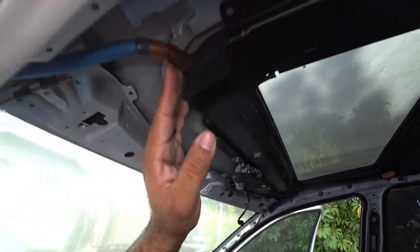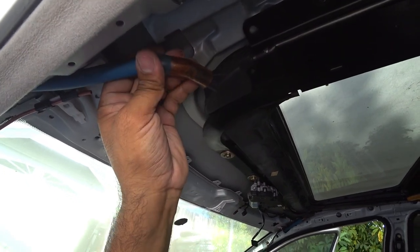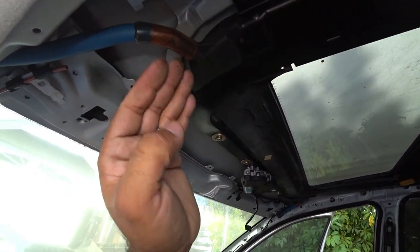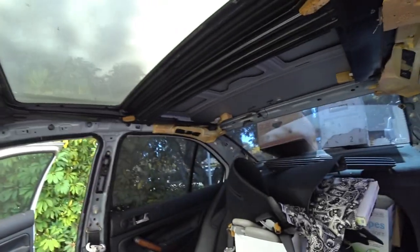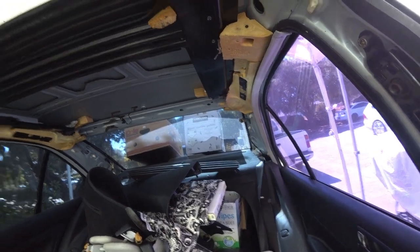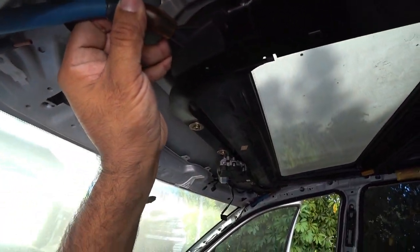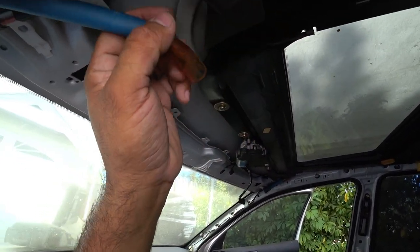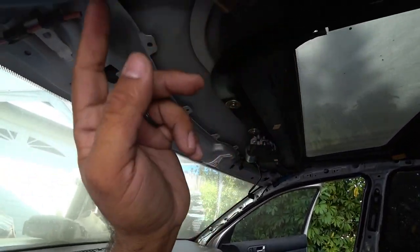We're going to put them with brand new tubes, but they're all the same size. This will solve the problem where your drain tubes leak. We're just going to fix the sizing and run new tubes all the way down from each corner. You get the proper size tube that mates up to this, which looks like a three-eighths, and run a tube all the way down.